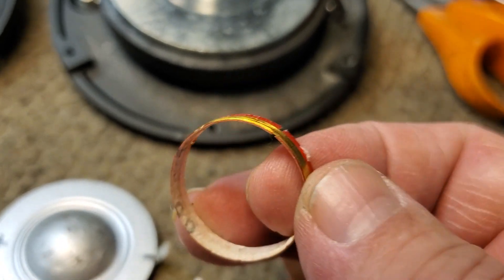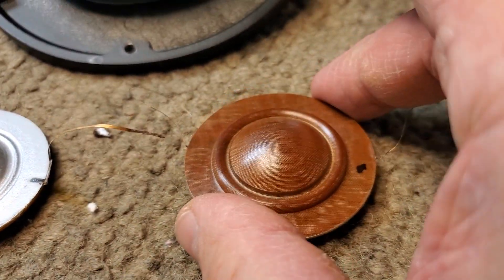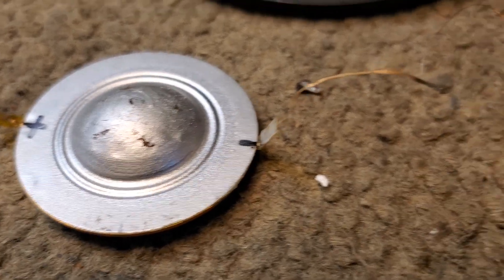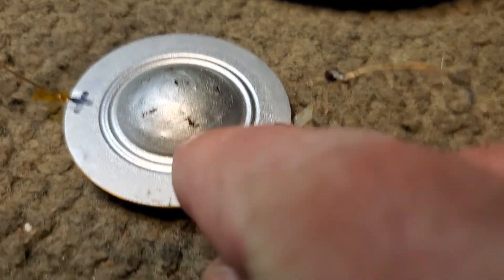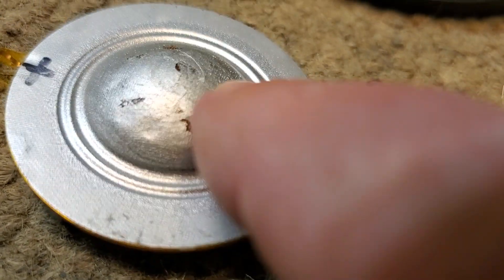If I think about it, I'll make a video of the end result. These are going to undergo a vapor deposition process to put some aluminum vapor on it — air quotes — also known as spray paint, because JBL, when their aluminum vapor deposition vacuum chamber broke, went to using spray paint. If this one has been touched up previously with some spray paint, when you see these pieces of aluminum that have flaked off, that's the aluminum vapor that has actually broken away from the phenolic diaphragm.